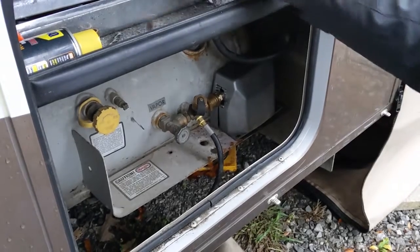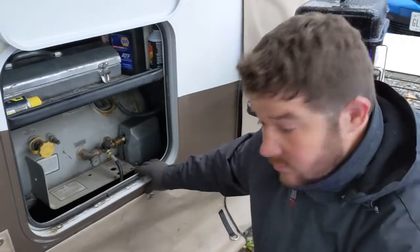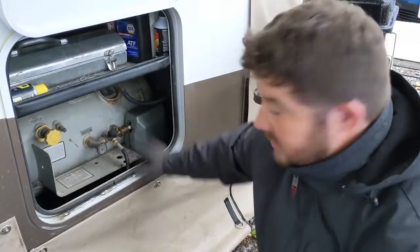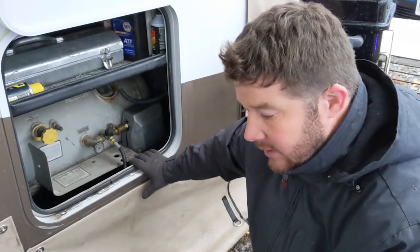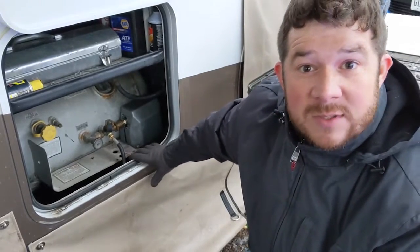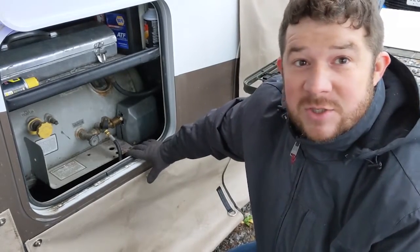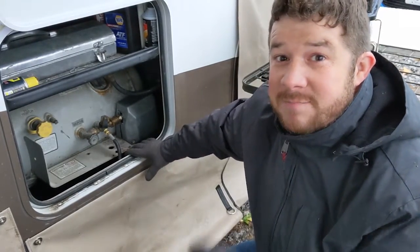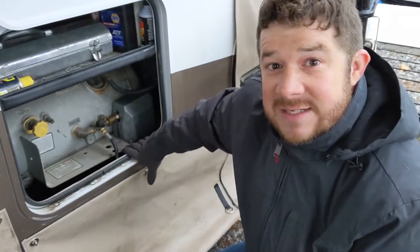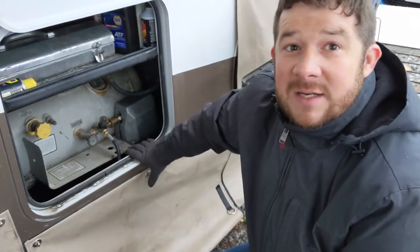So that's how you change a propane regulator. It's as simple as unscrewing the old one, screwing the new one back on, making sure you put Teflon tape on the threaded side, and making sure you have a cover on it. Other than that, easy peasy. If you liked this video and want to see more tips and ideas, browse the rest of our YouTube channel, subscribe, and click the bell icon so you get notified when we upload. Also check us out at henleyshappytrails.com and on Facebook. Until we meet again — happy trails!